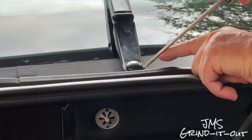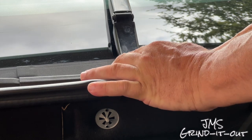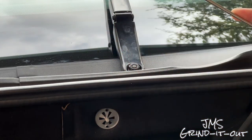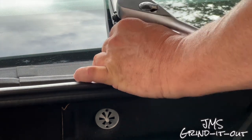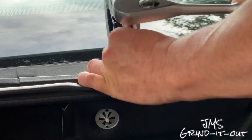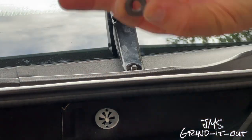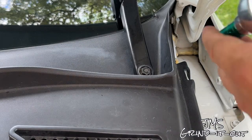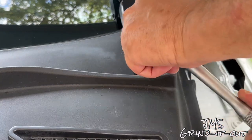You're going to have these plastic covers — that's where your screwdriver comes in. You want to pop those off first. Don't lose anything; put everything in a pile. Then your 13 millimeter socket comes in — it's as simple as that, get that nut off of there. It's not really tight in most cases. Do the same thing on the other one, pop everything off, take the 13 millimeter nut off, and then we're going to get to the puller.